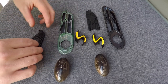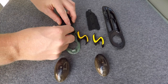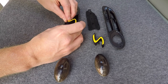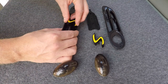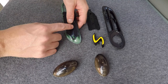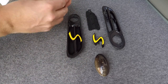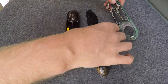Now to rebuild. Flip this over and click the grille in place — it goes back exactly the reverse of how we took it apart. Clip it on the back and make sure it's clipped at both ends. Get your S logo — there's a little locator here — line that up and push it into place. Sometimes it'll just hold itself; if you're nervous, put a blob of glue on the back to hold that pin in place. The last step is to hook your reflector back in following the exact same removal process in reverse. That's one side rebuilt.